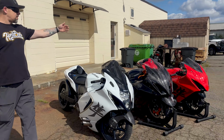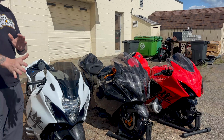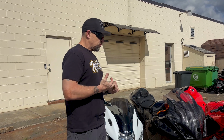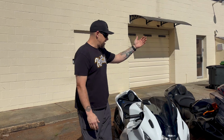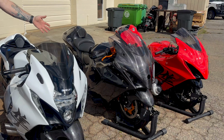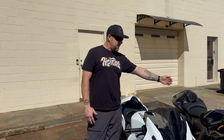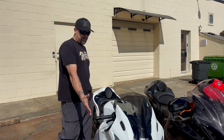If you move on down to the next, the carbon fiber bike, this is more of a time attack, gloves-off bike: make it as light as possible to go as fast as possible in non-drag racing form. It would be more of a roll race or speed time attack motorcycle. You take your stock Hayabusa, completely get rid of all the OEM fairings, and replace them with I1 Motos carbon fiber bodywork. We have a Montgomery Motorsports gas tank and BST wheels from Brock. The carbon fiber bike comes in roughly 100 pounds lighter in bodywork than the OEM configuration.